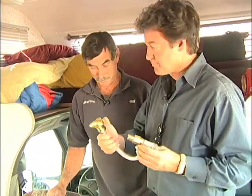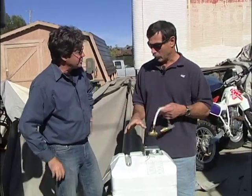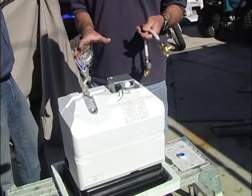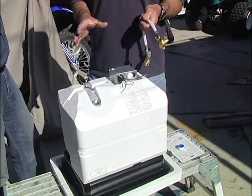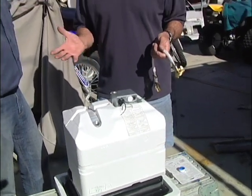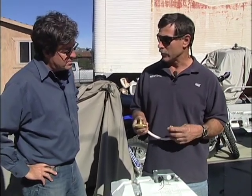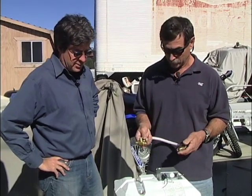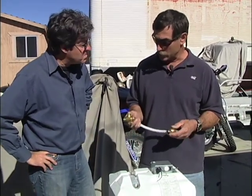Let's go outside and do it. If your water heater springs a leak, you can shut this off, drain the water heater, and it keeps your floor from getting drenched. There's also a nice extra benefit if you're winterizing your vehicle — you can shut this off and you don't have to fill the tank with six gallons of antifreeze and waste it.